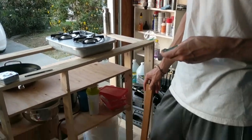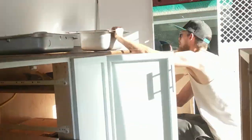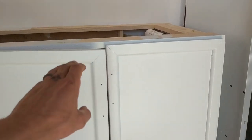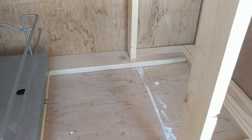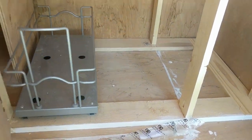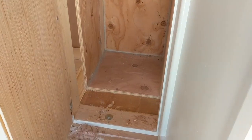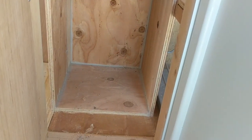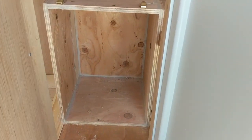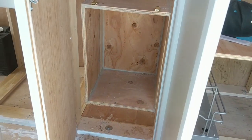Cabinet faces are next — we're trying to figure out how I'm going to mount the cabinet doors. I also got the lower kitchen cabinets in here, all installed, and we're just painting everything. I mounted those through the bottom of the van with quarter inch studs, similar to what I did on the bed frame — I put it through in four different places. I was a little limited because there are some frame rails that run through the van, so I couldn't get through to the underside in all spots. I still need to drill a vent hole in the propane locker. We'll probably go to Home Depot and pick up some PVC pipe, drill a hole, and insert the PVC so I can seal it — that way it prevents any water from getting into the subfloor or any of the wood.